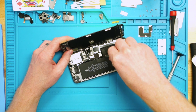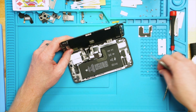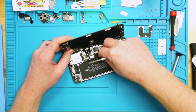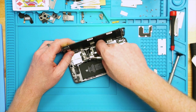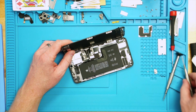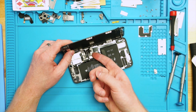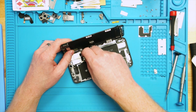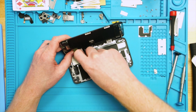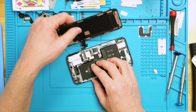Kind of going a little bit of an exploration here. That does look like it is the battery, so we're going to go ahead and unplug that. We'll be able to tell if the screen turns off — and there we go, the screen turned off, so we're good. Go ahead and remove the rest of these connectors here. Be very careful just like with any of the other models — I use my fingernail, I don't use pry tools unless I absolutely have to. I don't want to put any kind of marks or damage any of the components on the motherboard itself. Fingernails seem to be a little more forgiving than some of the other tools people use.